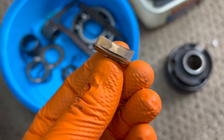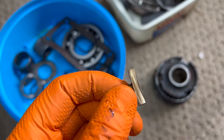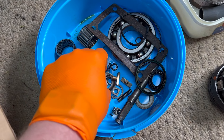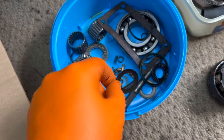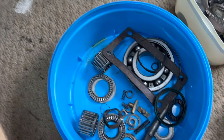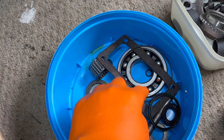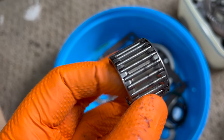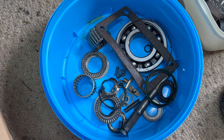These little shoes here locate the selector on the selector fork and move the synchro back and forth. They're quite worn — not very expensive — so I decided to replace those; I didn't replace them the first time I rebuilt it. As a demonstration of the heat that built up, that is a washer — or once upon a time was a washer. It's completely chewed and destroyed, and there's another one here. So I'm going to need some new spacing shims and washers for the back of it. I destroyed that circlip taking it apart — entirely my fault. This big bearing isn't overly expensive so I'll get it replaced, and these ones here have a bit of wear on them — that will get replaced too. Some are really hard to find or even unobtainable, but I'm going to take my time and make sure I get all the right stuff.